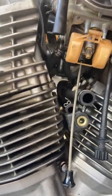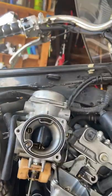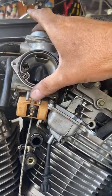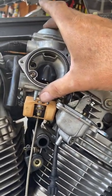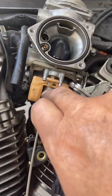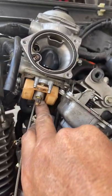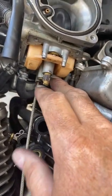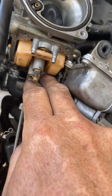What you need to do is remove your gas tank, as I did, to get to your carburetor. I did not unhook the carburetor completely because you don't need to. I cleaned the float, the main jet, and then the small jet.